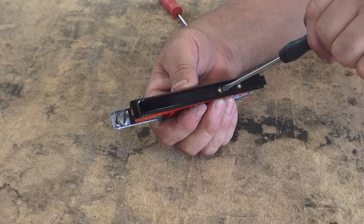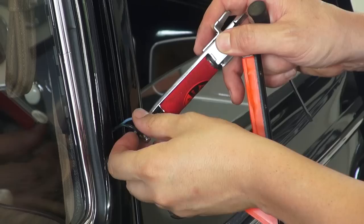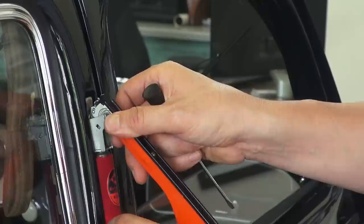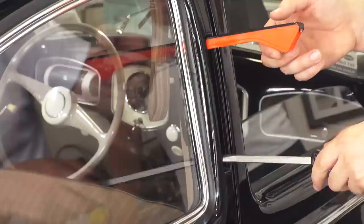Line up the holes and tighten down the screws — we are ready to install back into the car. There you go, how pretty! Connect your wires. These little wires can be finicky when installing back into the car; sometimes they've got to get tucked in first and then get out of the way when you bolt it down to the body. There's a hook on all these semaphores that has to hook into the back part when you insert it — make sure you hook it in and give the semaphore a little tug to make sure it's connected. This is adjustable once you start screwing it down, so make sure the semaphore is placed in a nice centered position in the opening. Do a dry run test fit and make sure it's smooth and everything lines up.